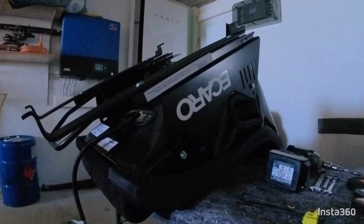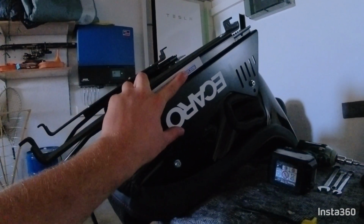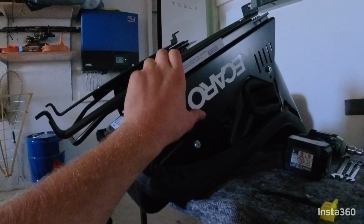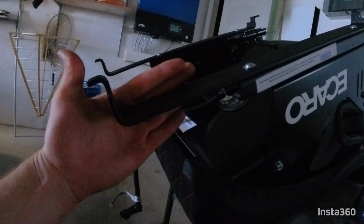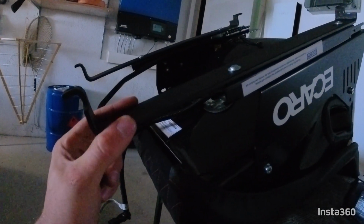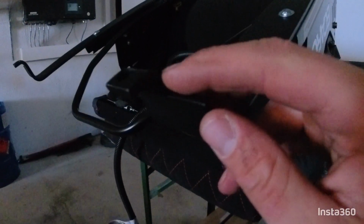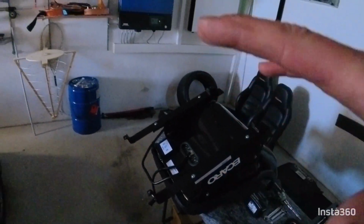And then I attached some universal sliding adapter things, whatever you call them, from Sparco. But basically you can use whatever you find. They're really not that expensive. I think a set was like 50 bucks, if that. And then to adapt it to the car, I made those metal adapter bars here. Basically it's just an iron piece, 2 inches wide and around 1/4 of an inch thick. You have to bend it like this, and I also made a little cutout here on the top so that it clears the carpet in the car and you can go all the way down.